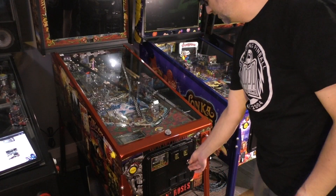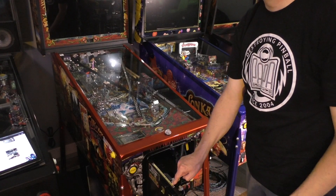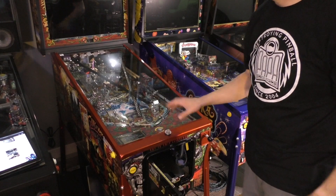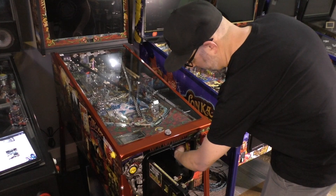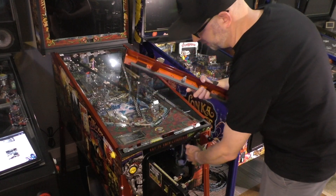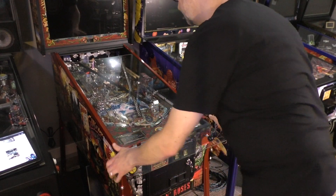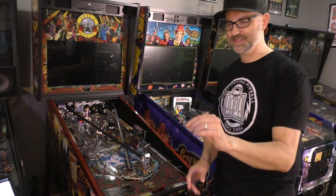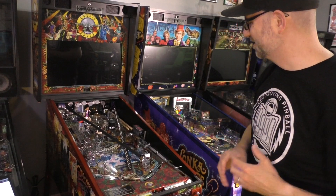If you've never taken the glass off of your pinball machine, you just unlock the coin door and open it up. You'll notice it says warning: close the door before handling the glass — that's very important because you don't want to scratch the glass, since it can hit the top of the coin door. Especially on JJP machines, or if you've got invisible glass installed. You just reach inside. On a Jersey Jack machine there's a lever — pull it to the center. Then the lock down bar comes off. There's a spring in it that will push it back to the right. Close your coin door, slide your glass off, and set it aside. If you have a concrete floor, don't set the glass down on it — a tiny little rock or chip touching the edge of the glass is gonna make it explode. That's gonna be bad news.